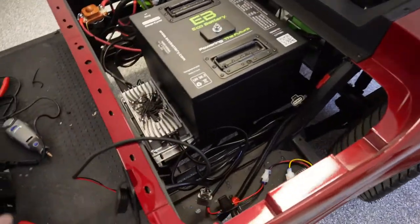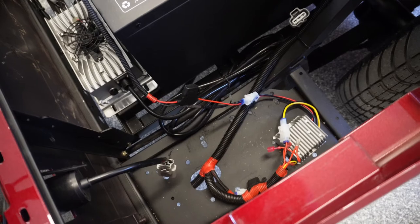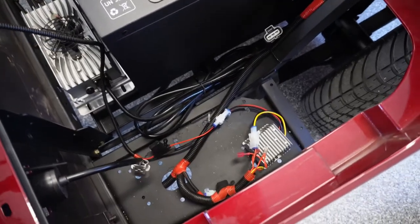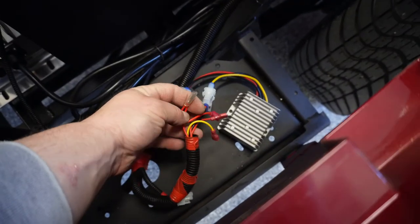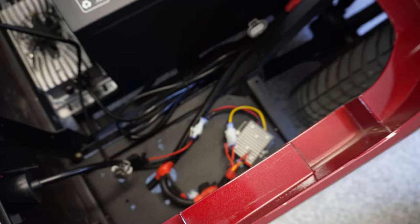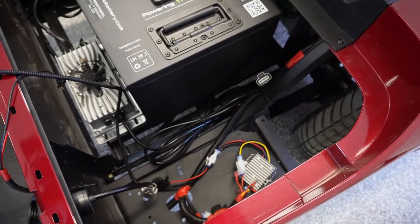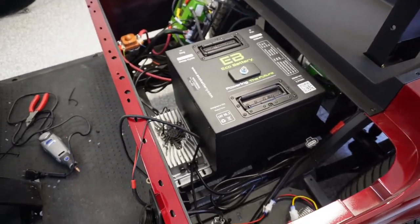We'll run back over here. This guy plugs into the voltage reducer, power negative, obviously, right to the battery for that. This is where you might get a little confused, and I've got to go grab that relay, but just follow the directions and plug them in accordingly, and we'll bolt our relay in there. And I believe that's for shutting off the voltage reducer so your battery doesn't go dead. I think I said that already. Okay, enough talk. Let's get some more work done.